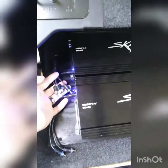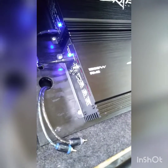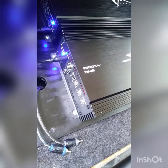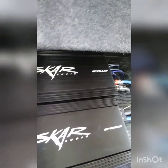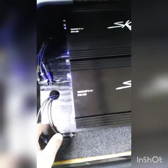Because you don't want any dirty signal here. What you're going to want to do is turn all your gains down to minimum, your low-pass filter wide open, your subsonic off — same thing on your four-channel amp. For the purposes of this video I'm just going to show you on the class D amp here, the Skar RP-1500, how to set your gains. It'll be the same thing for the four-channel — you'll just do it individually for each channel.